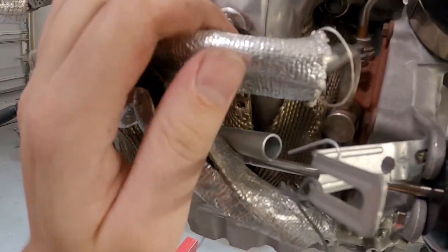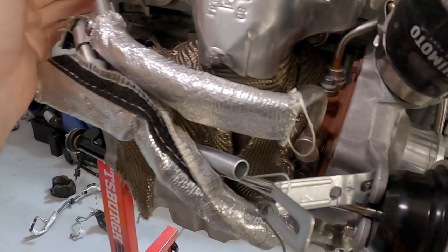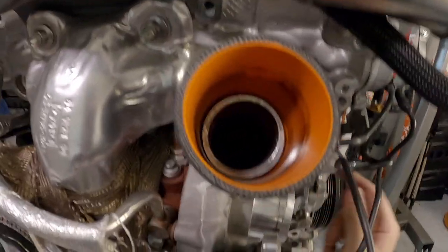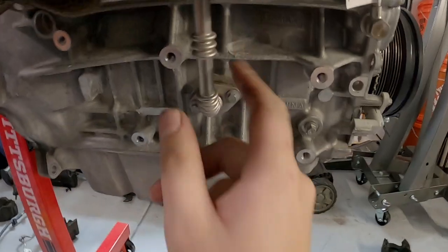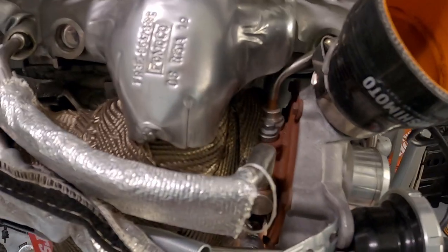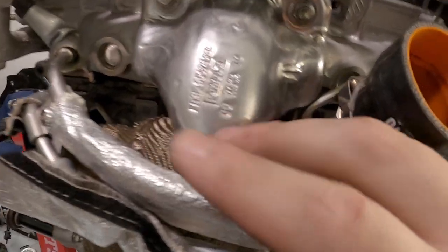That's why putting foil on here helped with temps - the car stayed cooler because the turbo wasn't superheating the coolant as it was going by. When putting this all back together, I might really wrap these up tight because it helped a lot. Here's the oil feed line and the return - they'll get covered in foil too, because this area gets really hot and you don't want coolant or oil too hot.